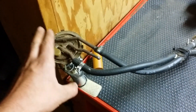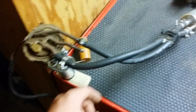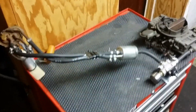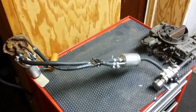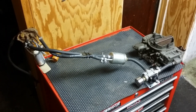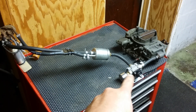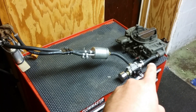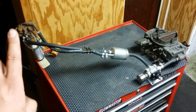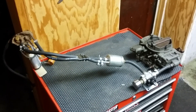These are still available on RockAuto. Buy the sender by itself without the pump — that's the best way — because they give you that cheap Spectra pump. Put a Walbro or a Delphi fuel pump on it. To summarize: pump, feed, return, Ford Expedition fuel filter, Quick Fuel regulator, Summit gauge — mandatory. Then to your carburetor. 12 volts fused and relayed and you're on the road. Hit me up guys and have yourselves a great day.